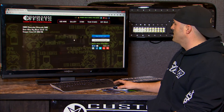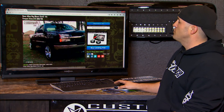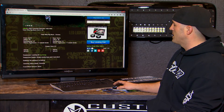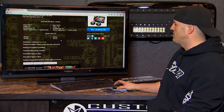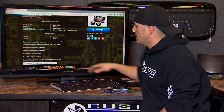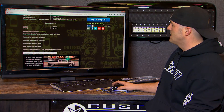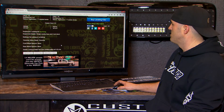This is one that popped up last week — pretty impressive setup. He's got 22 by 12 negative 44s on a 305-50. You can see that with just a leveling kit he was able to fit these 12-inch wide wheels with a 34-inch by 12-inch tire, 305-50. There's more details here too. You can see what kind of leveling kit he's got, whether there's rubbing or scrubbing, how much plastic trimming he had to do if any, whether the vehicle has spacers, and any other details about their build.